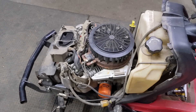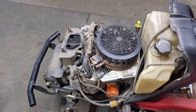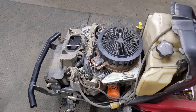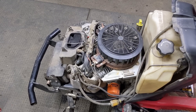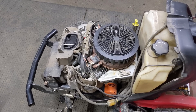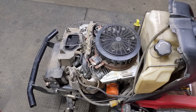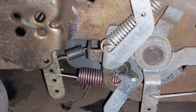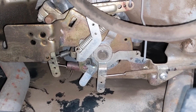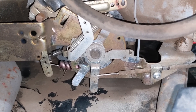That is how you fix a no-start on one of these Kohler Courage engines. What I did there was take the choke off to let you hear what it sounds like, then put the choke back on to let you hear what it sounded like — and then take it off again. Once the choke was engaged, the engine did start to sputter; you could audibly hear the choke creating too rich a mixture, causing the engine to run a bit rougher. Before reinstalling the plastic engine cover, I used an air compressor to blow out all of the governor springs to make sure there's no buildup of debris on them. That's going to wrap up today's video — if you enjoyed it, leave me a thumbs up, subscribe, and check the channel for new content every week. Thanks for watching!